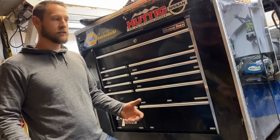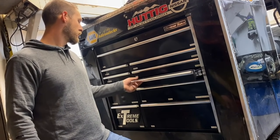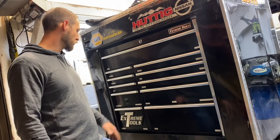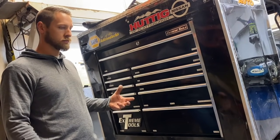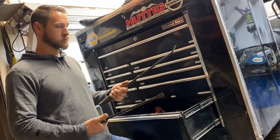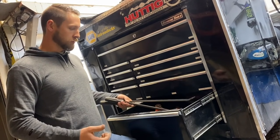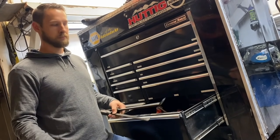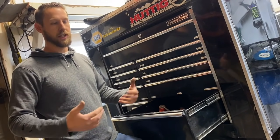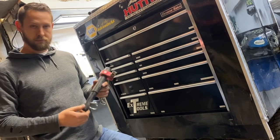If there's a red flag you'll have more time, so you want to be prepared for whatever you've got. Of course we have wrenches and screwdrivers and all the normal tools — what I'm trying to explain is what extra stuff you could have to be ready. A pry bar is also really helpful to get in and pry something, whether you're straightening it or just prying it to clear the tire. A lot of times the big issue is just getting the body away from the tire so a flat you've changed doesn't come back flat again.